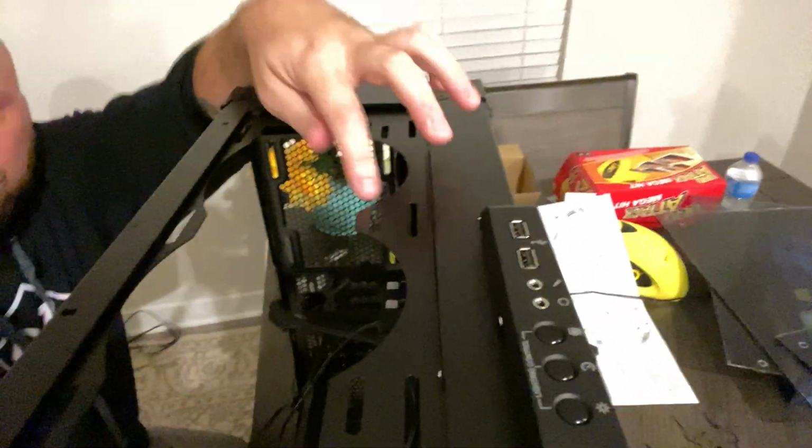All right, so it is almost 2 in the morning now, and I ran into a slight problem with the cooling system with the 570X case that I got. I thought I could do a top mounted fan system, but looking at the case here, it looks like there's really only a spot for 2 fans, which is kind of an issue because now I'm basically going to attach the radiator to the fans that are already here in the front. Those ones, I'm gonna attach it behind there. I'm gonna have basically 3 fans that serve no purpose. So if anybody needs some PC fans, I'm your guy.